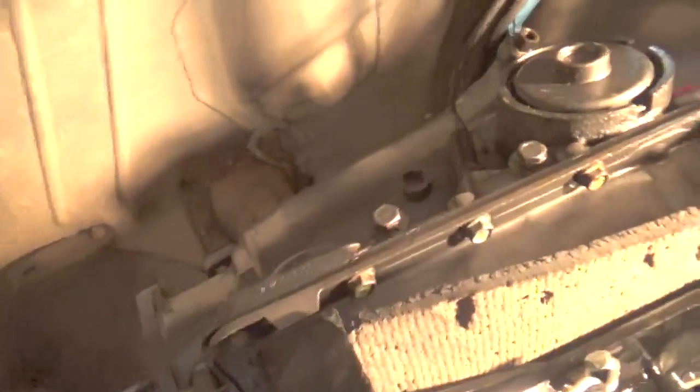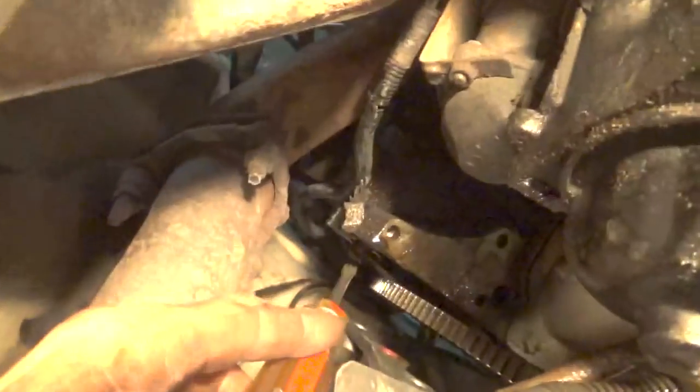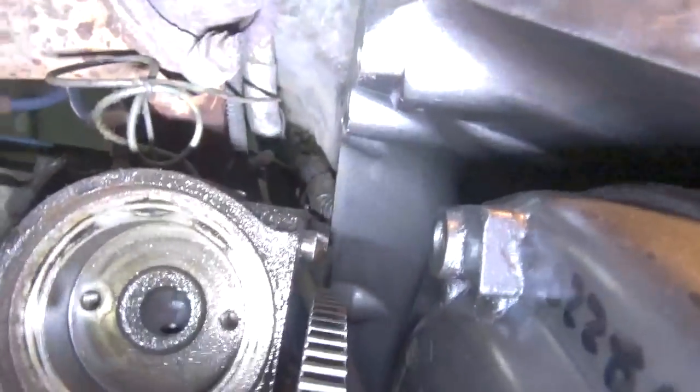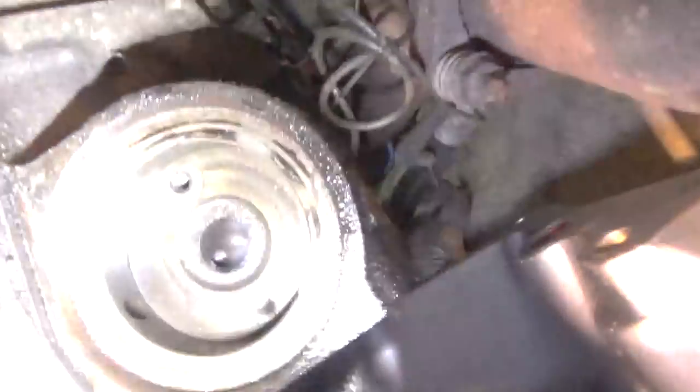Now the other thing here about a Chevy, I've never seen any that don't have it, but there's always a first time, is when you line the transmission up, if you look here, there's a dowel pin right in front of that screwdriver. Can you see that there? It's a dowel pin. Let me get a flashlight. So that dowel pin, there's one on each side. Right there you can see it sticking up. That dowel pin, there's one there, and there's one on the other side right there. Okay? That shiny thing we're looking at up there. So there's two places on the transmission where they fit in.